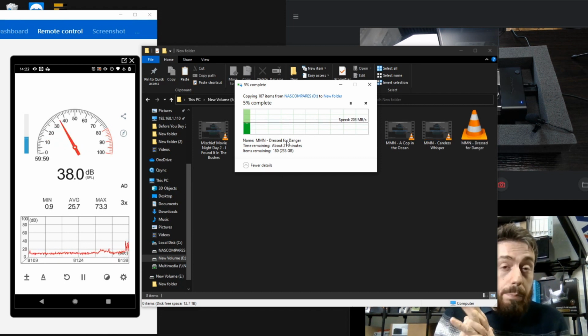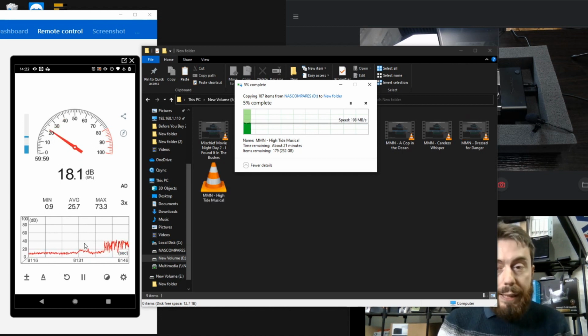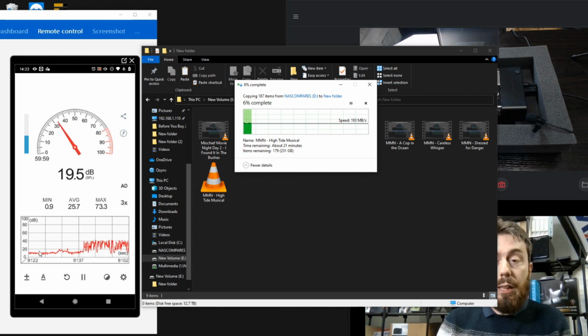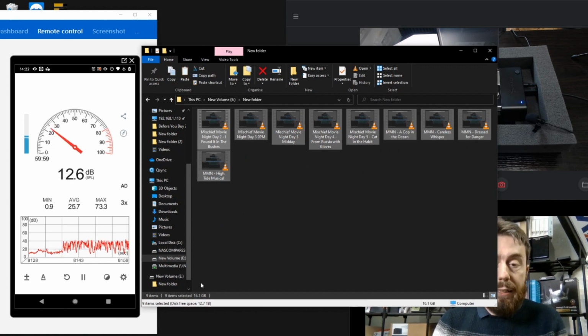So the performance there is pretty consistent, living in those 200s. On top of that, the performance there, not a lot of noise as we anticipated. But again, it's the next test where we flick between read and write rapidly where we're going to start to see that noise. So if we end that suspended area there, we go ahead, grab that data, equaling 16.1 gigabytes